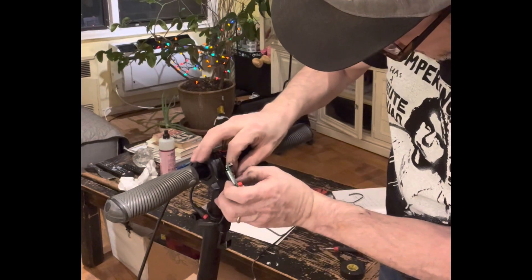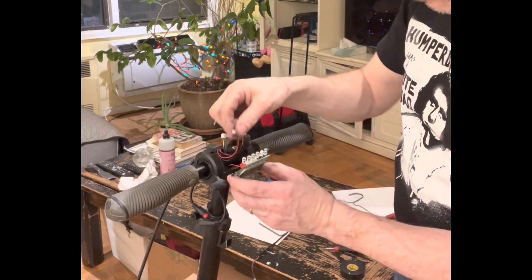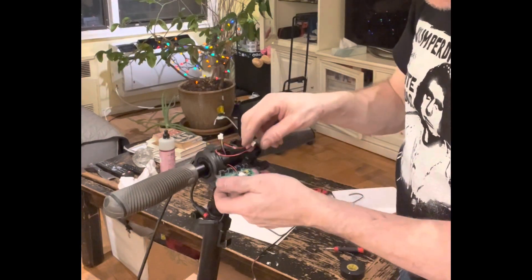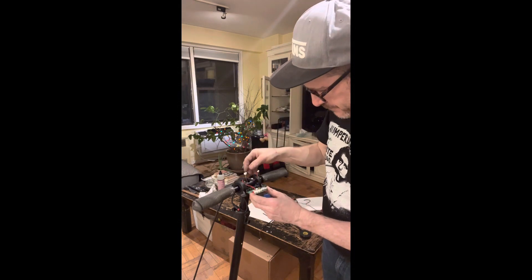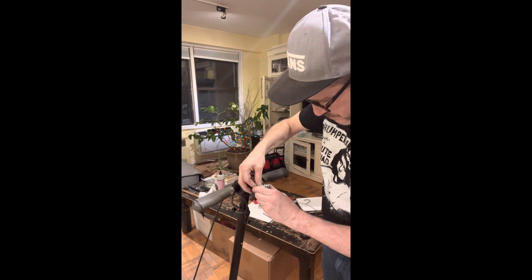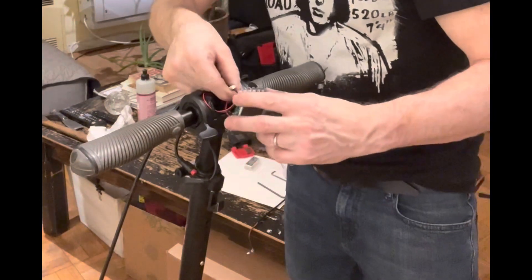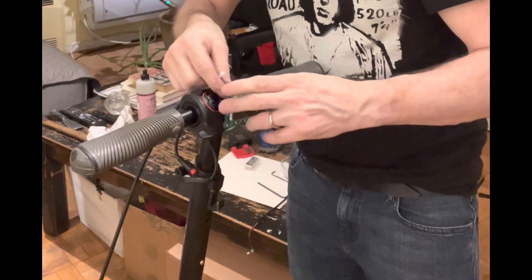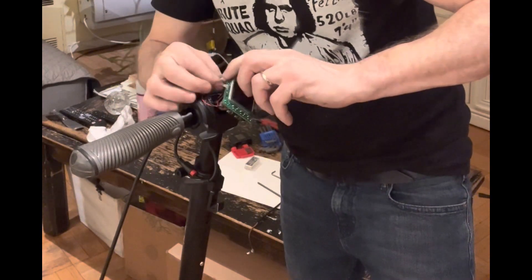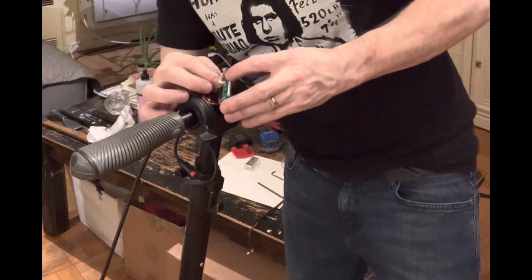The lights go to the front. There's a red and black that goes for the brake controller and a red and black that goes for the throttle controller — make sure you put those on the proper sides because they're the same connector. The brake lever side goes to the left-hand side, the second one from the left. Just pop that in. Next to it goes the throttle controller, just press that in. The next one is the wire coming from the control wire, which has three prongs and goes right into the controller right there. The last one is the two-wire that goes into the red connector.